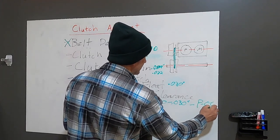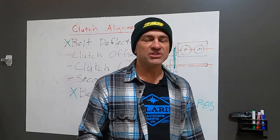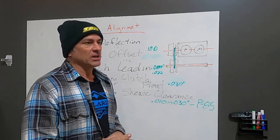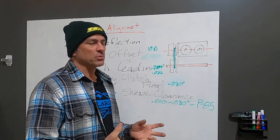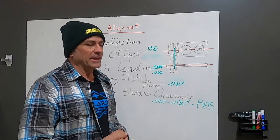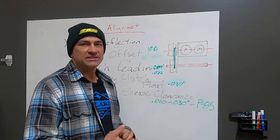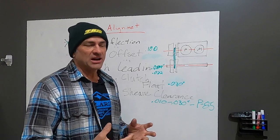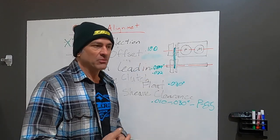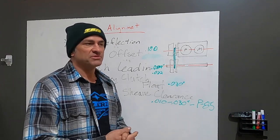We made some significant movements in our clutching on our boost, and it should make a pretty significant difference. I'm not going to touch anything else on the clutching. Last time we had this out a few days ago, before we did all these changes, we really weren't able to get over about 8,100 RPM in really deep snow on a really good climb. We're going to see what difference it makes — we're taking it out Monday with more snow coming. This should affect our clutch heat, and I'm thinking it's going to affect our RPMs a lot, since we've fixed the alignment issues.